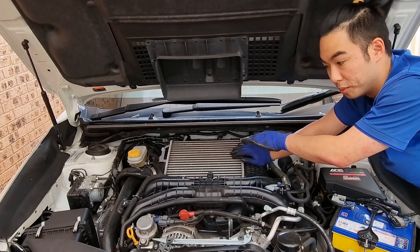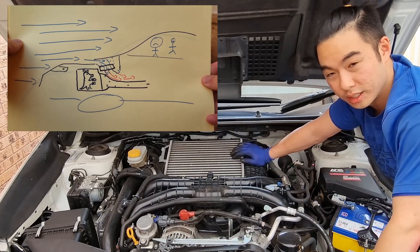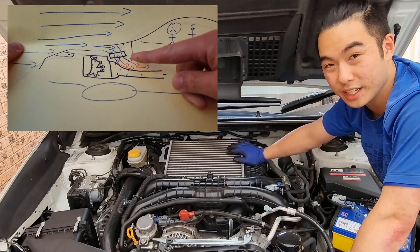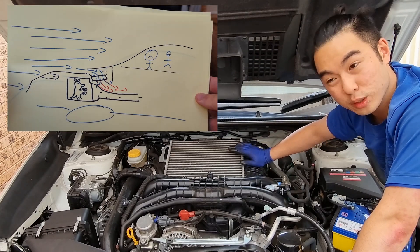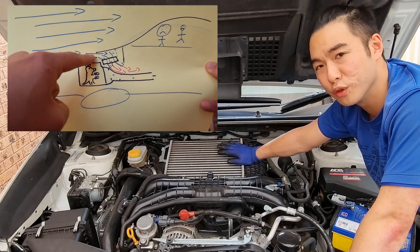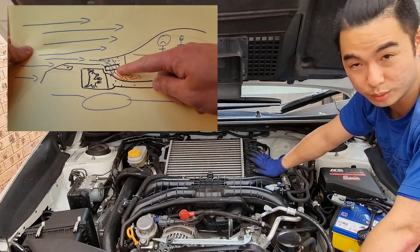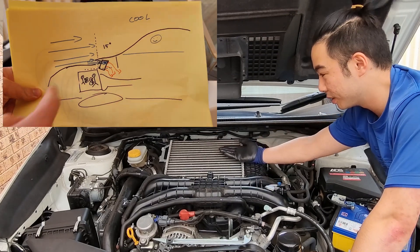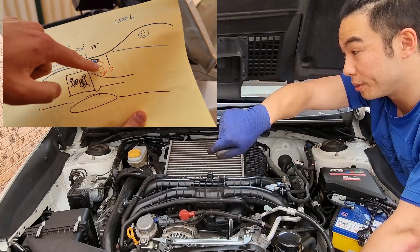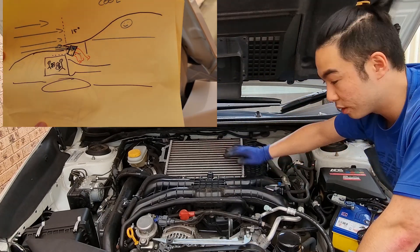The stock intercooler is lying almost horizontally, so the air coming through the hood scoop has to change direction and go down before it can hit the intercooler. As the air comes through and cools the air going into the engine, there's excess air that has to go somewhere — it needs to exit the engine bay underneath the intercooler just behind the engine. Because it's lying so flat, the air has to change direction once to hit the intercooler, and again to exit through the back of the engine bay. What the verticooler does is sit almost vertical — just 15 degrees off the vertical axis — so the air goes straight into the verticooler without changing direction, and exits through the back without a change in direction.